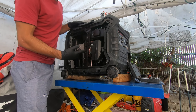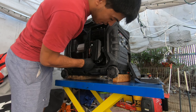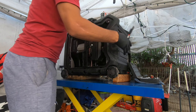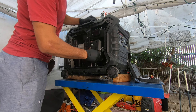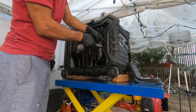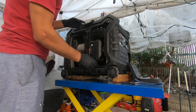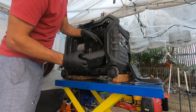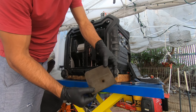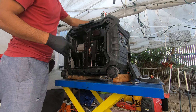I attempted to start this generator and it did not even puff once. So the first thing I usually like to do so I don't waste my time is clean the carburetor. I got a few tools and we're gonna be pulling this carburetor. First things first, there's a breather hose on the airbox lid — if we just unplug it, the lid actually comes off. Here's the lid and the air filter, which has definitely seen better days.